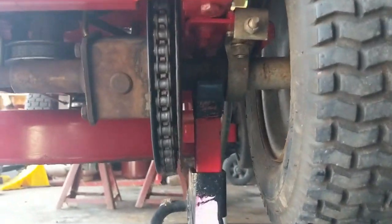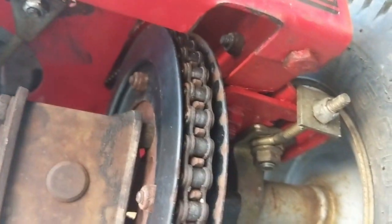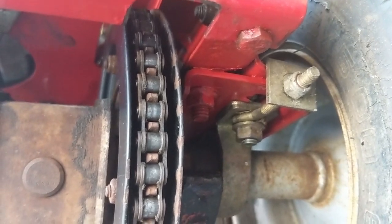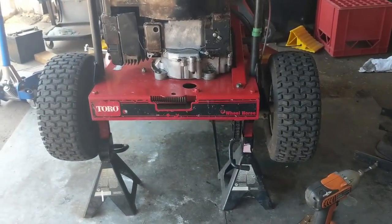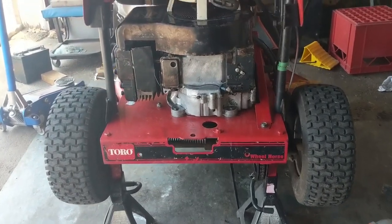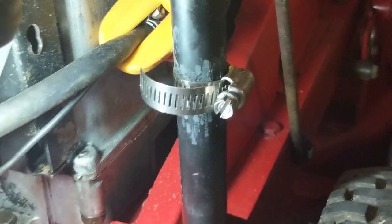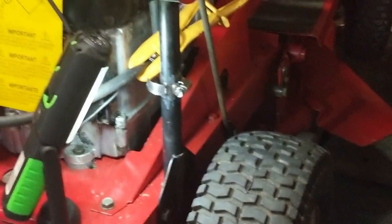The reason I did it this way rather than dropping the axle is that the sprocket is right there in the box frame, making the nuts extremely difficult to access. You'd have to drop the axle and take the chain off — a lot of work compared to just cutting it and putting a pipe clamp on. I used a hose clamp for now; it's stable and doesn't move when I shake it, so that'll do.